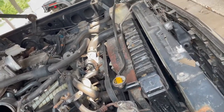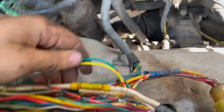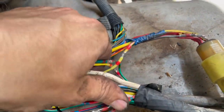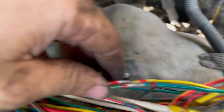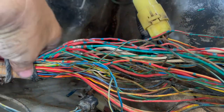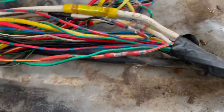Rats chewed through a bunch of wires. We started digging into this thing and found the main harness coming into the engine — about 30 wire repairs we had to do. We used all heat shrink solder seal wire connectors, which I really enjoy using. They do a really good job and they're completely sealed up. I was able to trace back the wire colors all the way back to the main harness penetration, find the right wires, and connect them to the right colors wherever they were broken or chewed off.